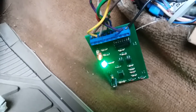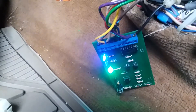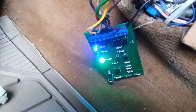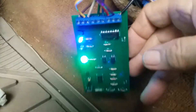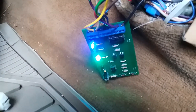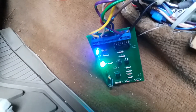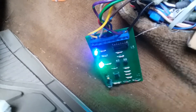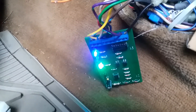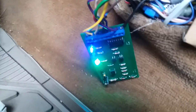You can have any mix of hot or cold that you want, but it's a manual choice. When you reach full heat, the red LED stays on. If we want to go back to full air, we just twist it up to cold — the blue light comes on and it travels up until it reaches full high. The fan speeds pick up to high speed for full air conditioning — low speed, middle speed — then low speed and stopped.